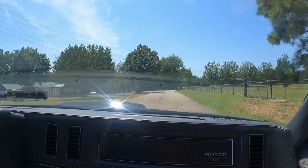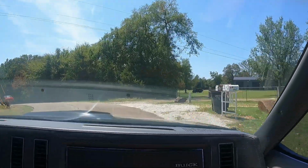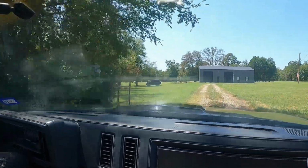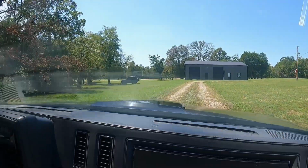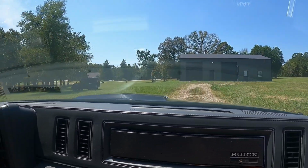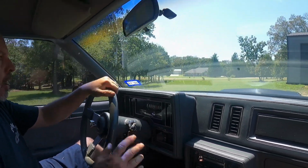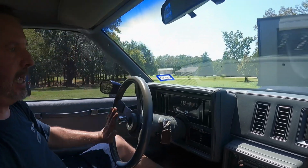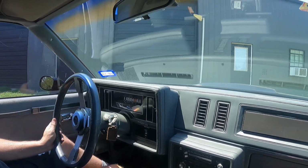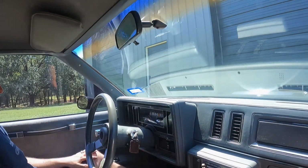That clatter though, definitely, y'all know that's not good. I don't know if that's detonation or just bad fuel. I put 91 non-ethanol in it, but I probably need to put the octane booster in it. But here's the thing I need to know from you guys, that inlet air temperature sensor, could that also be part of this? Like I said, I gotta get the Scan Master, and we need to see what this thing is doing as far as it going lean. I don't want to damage the car, but now it's running like it was.